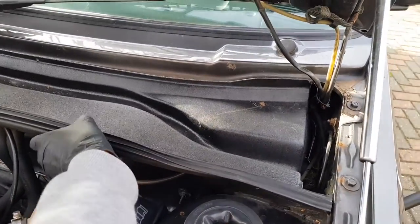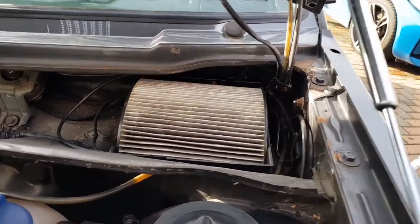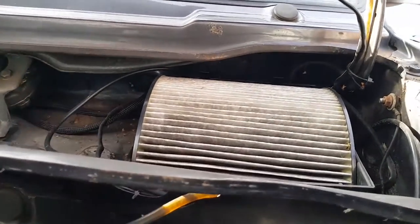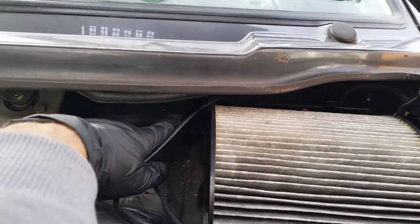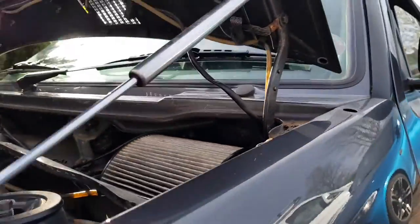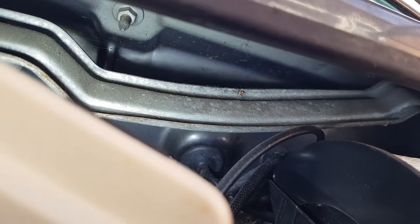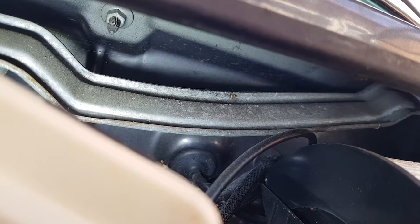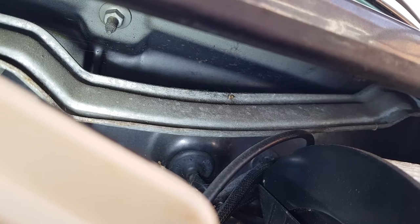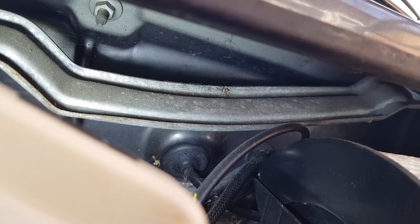Let's get the scuttle out of the way. The actual cable for the aerial runs through a grommet back against the bulkhead. I'll try to get a light on there but it might be difficult to see. You can just make it out behind the pollen filter - it's a bit of a pain to get the cable in and out of there. The best way I found was to use the original aerial cable that will already be there in place.